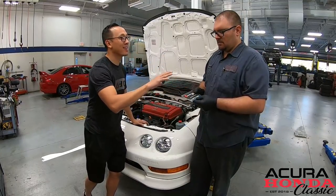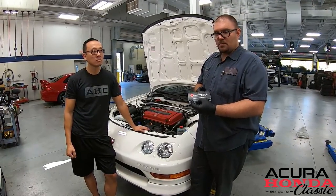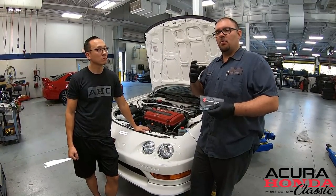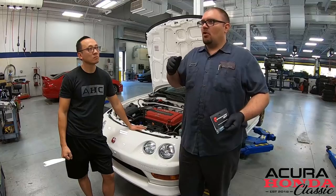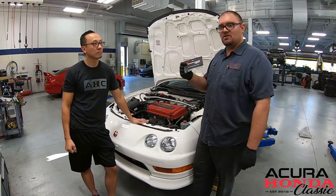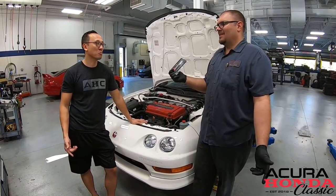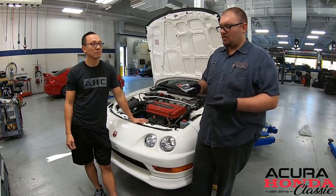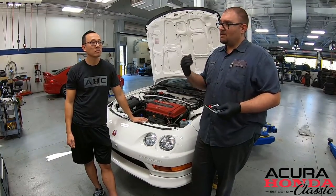So what is the difference between this one and the OEM one? The real difference is they went with a slightly longer spring and a different stiffness in the material, so that puts more tension on the ball bearing — in other words, making it hold in gear on that detent a little bit stronger, giving you better feel overall and more resistance. And the best thing is it's probably the cheapest mod you could do on one of these — right around 30 bucks. It's nothing, and with deals like Black Friday, you know the quality is very high from Speed Factory.